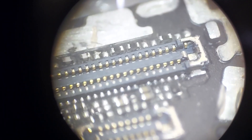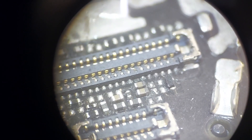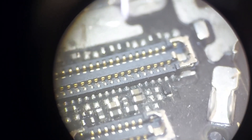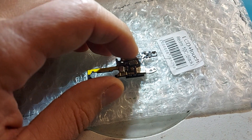The main board is fine, but the lower board is damaged. As you can see, there are damaged connector legs above the two grey ceramic capacitors. If you count, this is contact 7 counting from the right side.